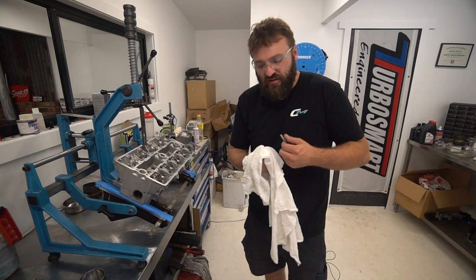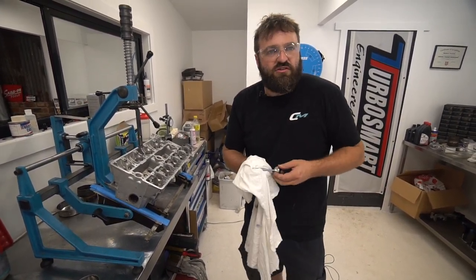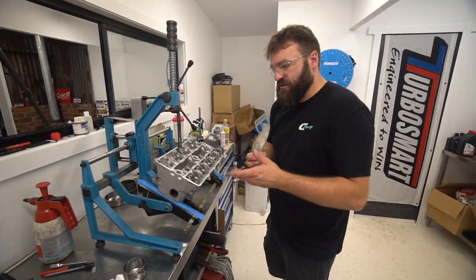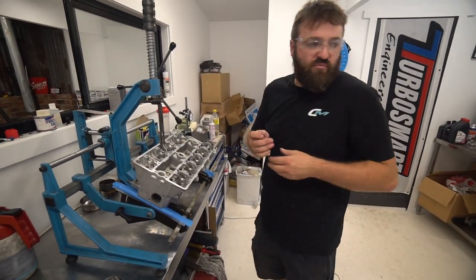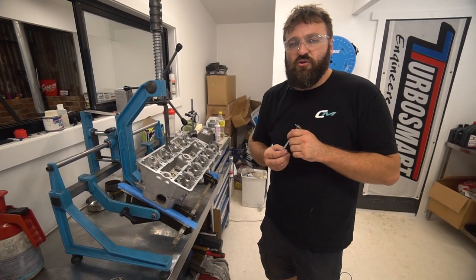As long as you've got something, it doesn't matter, which we learnt with yours. They closed up a little bit, so we had to just reshim them. This makes it a little bit more difficult when you go to a shimless, because you've just got to know what buckets were in there. So in my book there, I've calculated the bucket sizes, my corrections, and I record those.